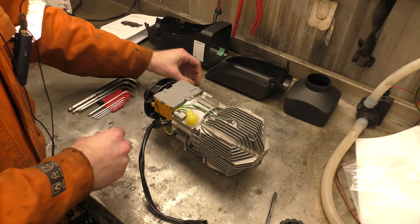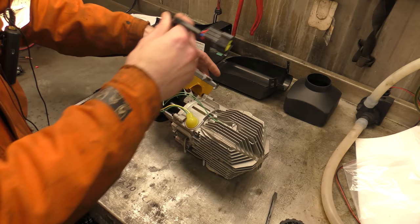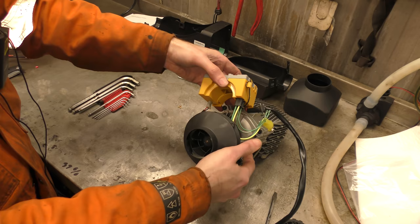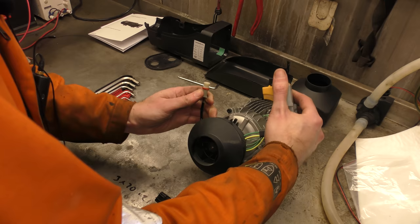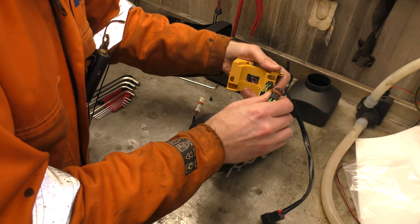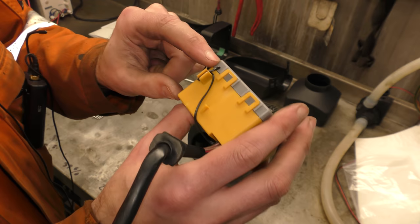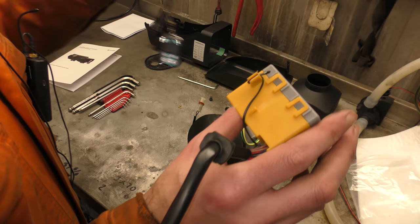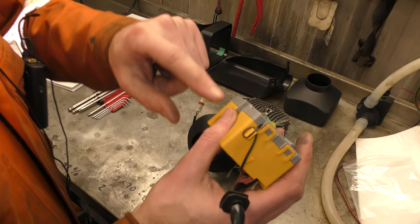One of them on the top — it still lets you squeeze the things in to remove the ECU box. On one side we have the fan motor connector. Oh, these are proper actual Webasto-style connectors. We've got the glow plug and we have the overheat temperature sensor, the one on the body. I'm curious as to what this temperature sensor is for — because I presume this still has one in the housing of the LCD controller, since you want that in your van to measure the heat in there. But it's also got one on the body. That's interesting.